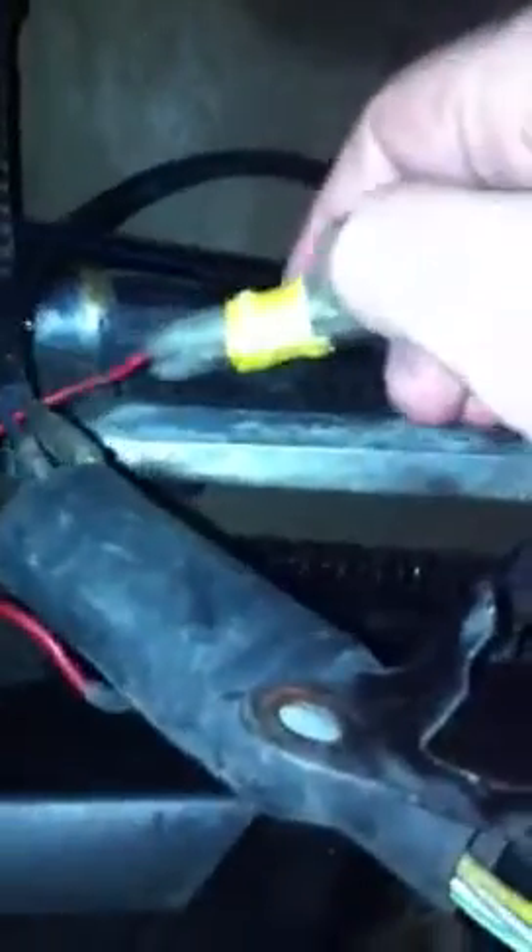When I turn it off, if we had a voltage — which I did recently, it was one volt — the way we test for shorts is by going through and eliminating things, just the same as on your car. On this bike, the first thing I looked at was this front blinker. You'll notice it's been bent slightly. So I pull out the light bulbs one by one. On a car you have a fuse box; on a motorbike you don't. You have a single fuse, which is over here in this housing. To find your voltage leakage, you slowly disconnect things. If I pull out the light bulb here and the voltage goes back to zero, that tells me this was the problem.